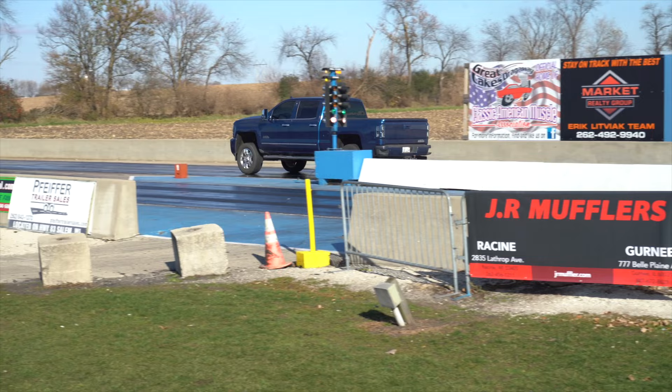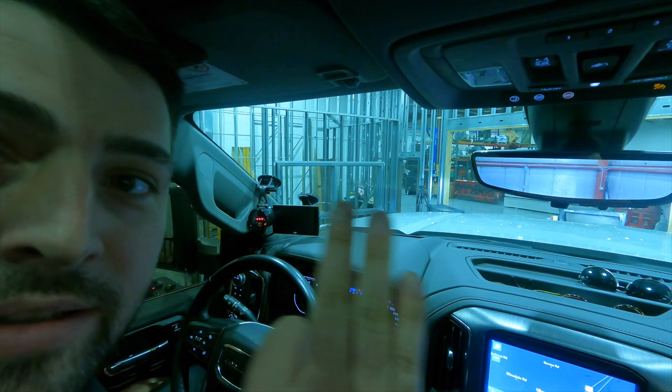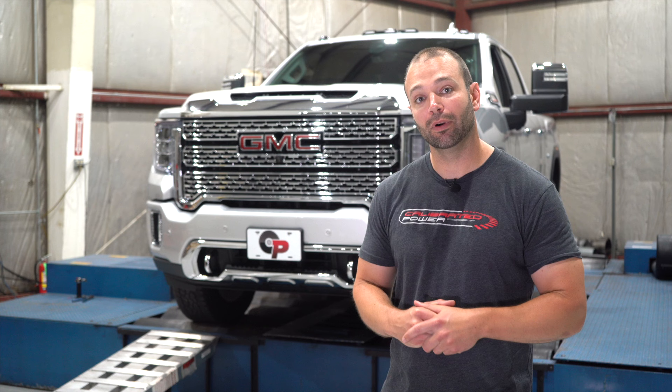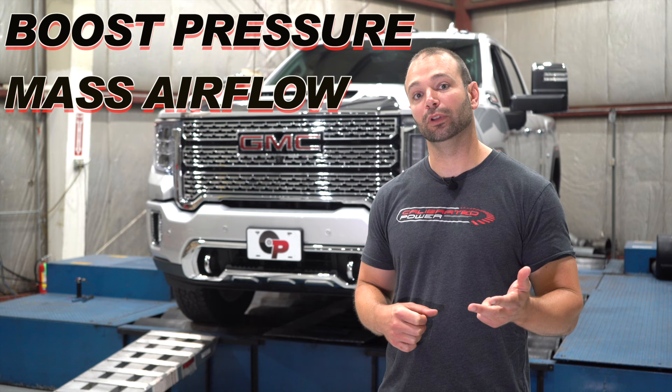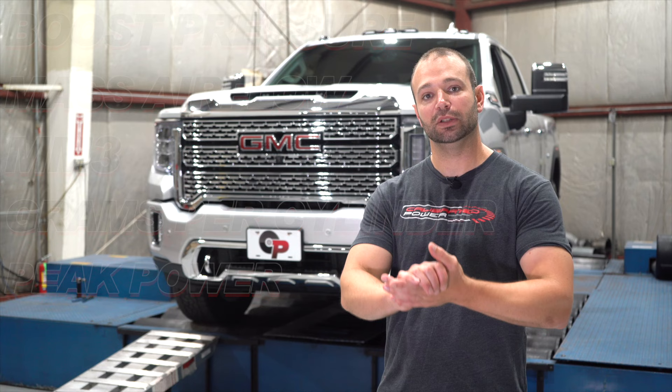Because we're a little bit on the nerdy side, we like our measurements. We're going to use HP Tuners and log every run. We're looking at boost pressure, mass airflow, fuel flow rate, grams per cylinder of airflow, and peak power. We're going to look at all those pieces and try to get a clear picture of what's going on as we change from one intake to the other.